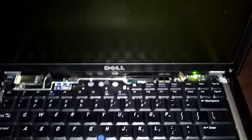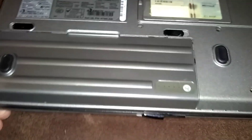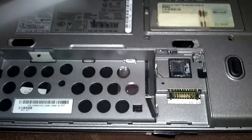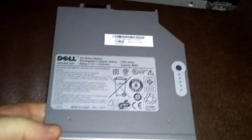We shut the computer down. Now we're going to remove the battery and power cord. Here's your main battery — you're going to pull the two tabs away from each other. I also have a battery over in the modular bay, where your CD-ROM is located. We're going to remove that battery too. I'll leave a link in the description on where to buy this one. This is an extra battery. Got your batteries out.